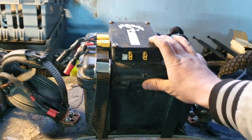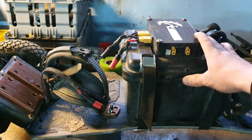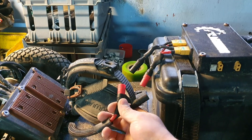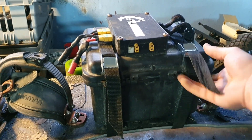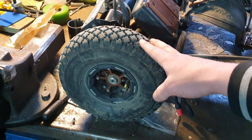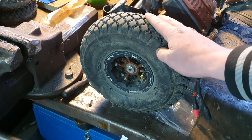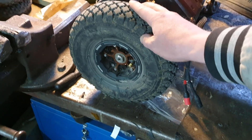This battery box is about 14 kilos — that's pretty heavy for a battery. Since I've done this plug-and-play solution, I can easily just remove this battery box, put on a lighter one, and then put this on later when I want to go for long rides. The other thing I'm going to do is change back to 8-inch tires, because these rims and tires combined are about 1 kilo each — that's also very heavy.